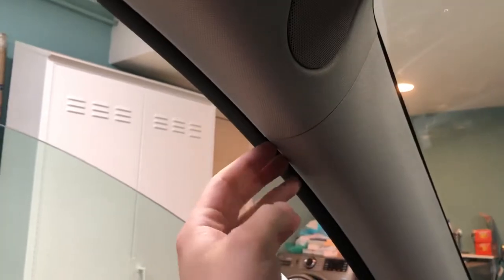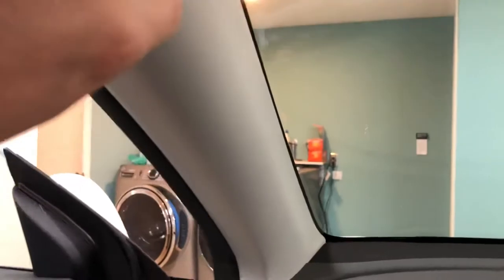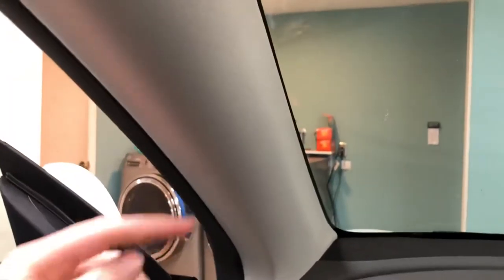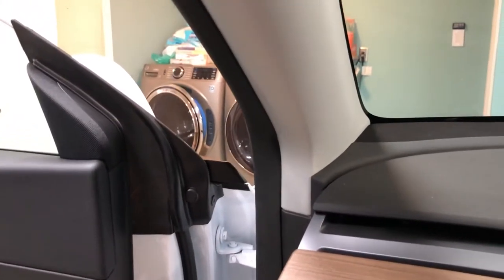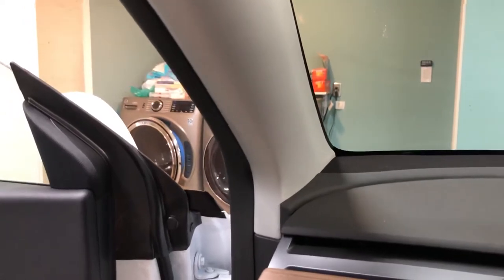To remove this piece, come in at the top and reach right through here — you can actually pull it out by hand. Move the rubber piece out of the way, slip your finger in, push it towards the rear view mirror, and the top will pop out. You'll see the airbag running along the bottom side, and along the top a set of wires — I just zip-tied my wire to those to keep it out of the way of the airbag. You don't need to remove this piece entirely; once you pop it out you'll have enough room to see behind it and drop the cable down, which will save you the hassle of trying to wedge it back into the tight gap as you may have seen on other YouTube videos.